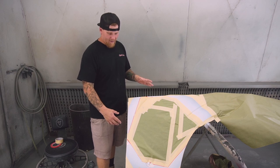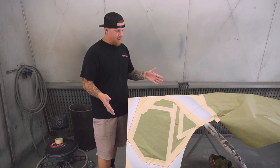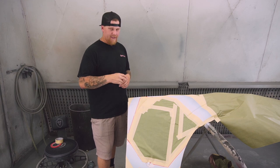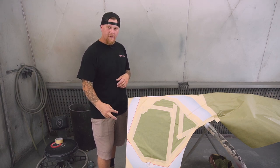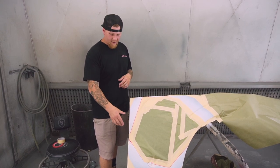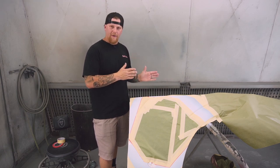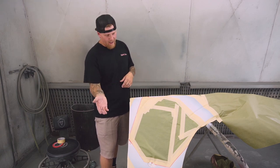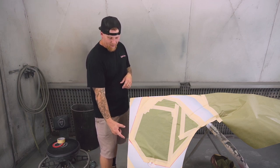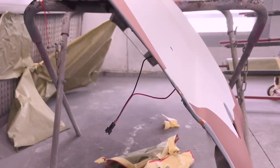Prior we talked about how the backplane has two leads. Now that it's actually mapped out, you guys can see it, because I don't want to confuse you. There is only two wires to connect to this. The only reason we have two on the back plane this time is because on this bus bar, and I know I've said back plane, bus bar, it's the same material, you're just using it twice, one in the beginning and one in the fourth stage. So these two wires with the copper are actually going to be tied together with a jumper in the backside. So there's only a positive and only a negative.